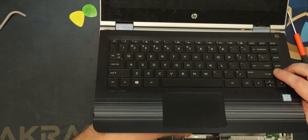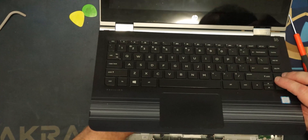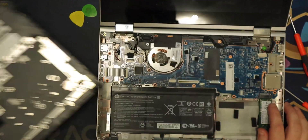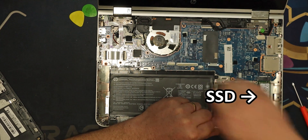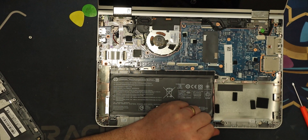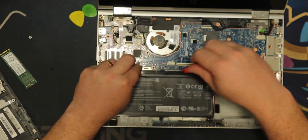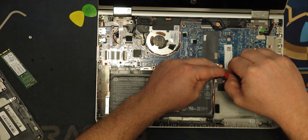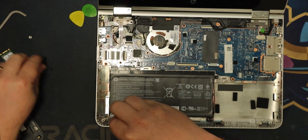Once you've lifted up the keyboard, there are two ribbons underneath. You need to lift the little clips on those to pop the ribbons out so you can remove the keyboard. Once you've got them out of the way, you can undo the screw securing the M.2 SSD. If you want to do a hard drive upgrade, make sure you have your backup media or a fresh version of Windows ready to install. Your CD key is built into the hardware on this device, so if you don't have the original media you won't be able to get that CD key out. There is software that can extract the CD key before you do this, but you will have to wipe everything and start from scratch.